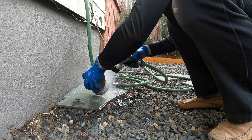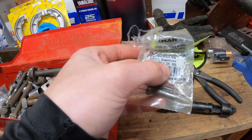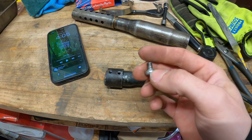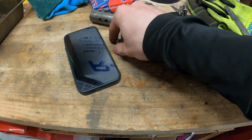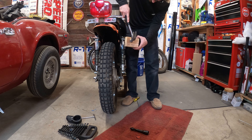I'm going to keep all my carburetor stuff in this pan so I can't lose it. This is the exhaust baffle and I'm missing the screw for it. I happen to have some stainless steel Phillips head screws but they're a bit too long, so I cut one down and filed the end to a nice bevel so it screws in properly. The thread size is M6-1 and it should be about 5 or 10mm length rather than the 25mm I had. Unfortunately the bike got laid over while I had it apart, so it flattened the tube a bit.